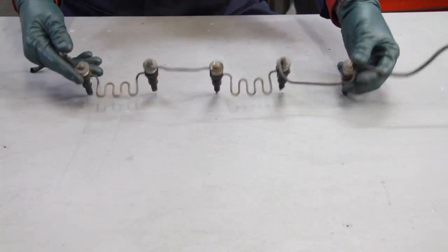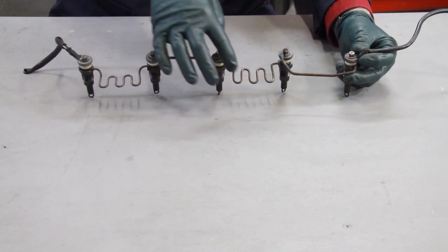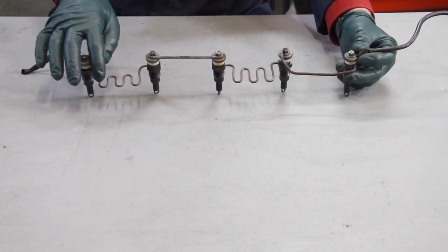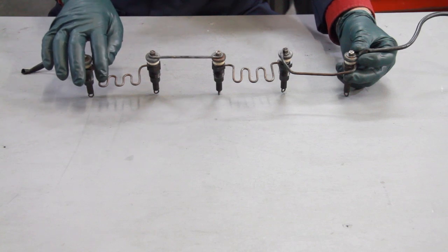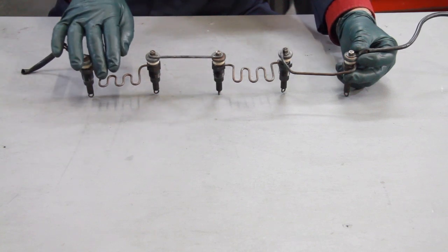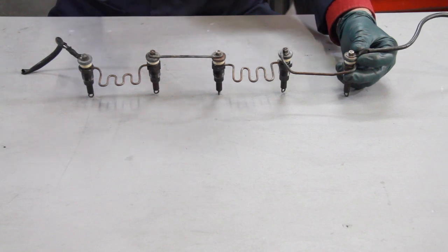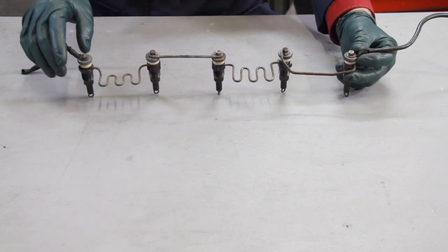The next series is pretty much the same as the early series, but notice these funny-looking wires here. Those are resistor wires, used to replace the ballast resistor. These started showing up in the late 60s in the 220D, then in the 240D and early 300D up to 1979.